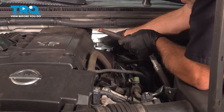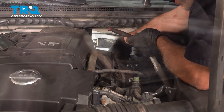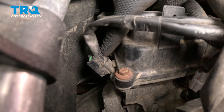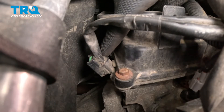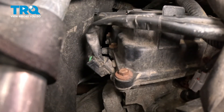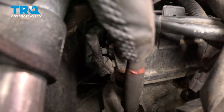On the back side of our valve cover, we have our sensor right here. This is basically positioned right on the back of the cylinder head, but it's kind of angled — roughly a 33-degree angle. On the bottom side of this connector is a 10mm bolt. The only way you can really get to it is to reach down along the back side, and I'm going to use a 1/4-inch ratchet and a 10mm socket.